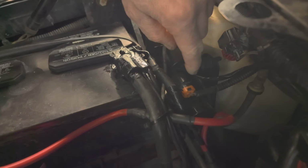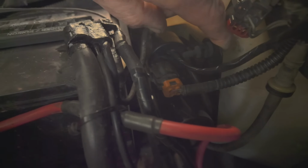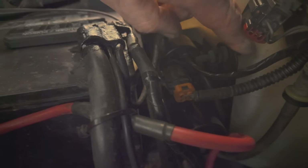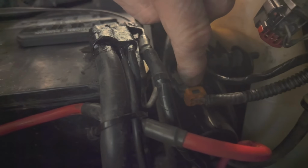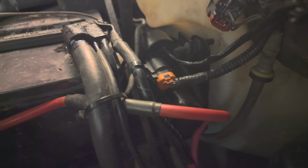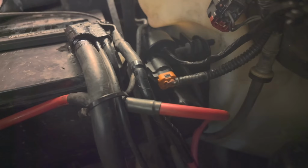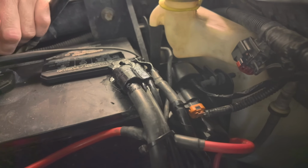I'm going to try to show you guys, but it's basically right here. There's where the wire comes out, and then I've put the little relay right here. It's really tough to get the camera in there to show you guys. I didn't film installing this because it's not that big of a deal. Basically, there's these little rubber grommets you pull through. There's 3 of them, and that's all that mounts the pump to the bracket. And then you have your power connection, and then you have your vacuum hose connection right here, and that's about it. So yeah, we're gonna give this a try this summer, and it seems to be working really well now with the key on. Before, there's many times where I've turned the key on and this thing wasn't even kicking in, so hopefully that's good now.